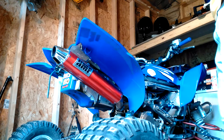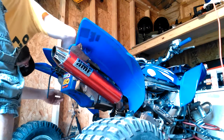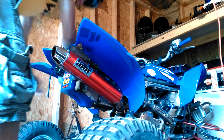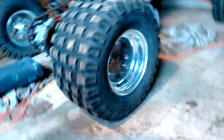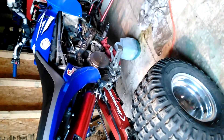Touch that up with some brake cleaner to get it off. Over here, while that drains out by itself, undo the two bolts on the reservoir, flip it over, and drain it into a pan if you can. Just let the reservoir bleed dry.